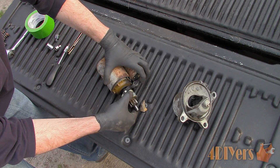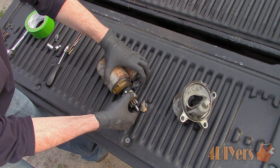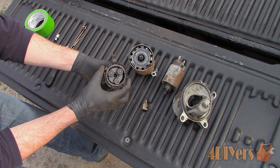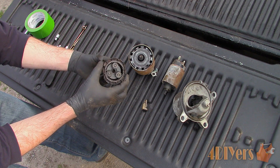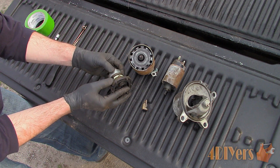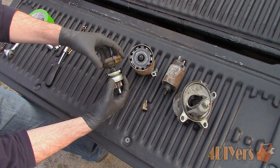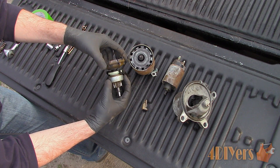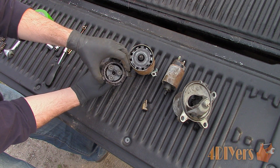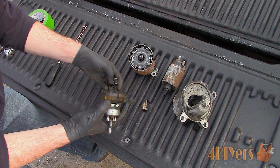The movement of the plunger operates a lever that pulls out the pinion gear. Here we have the final drive assembly. This unit is what gives the starter motor its torque so it's able to have enough power output to turn over the engine. Designs will vary between starters so not all look the same, but will have some similarities. There is a gear on the armature shaft and a planetary gear set in the final drive assembly — roughly a 5 to 1 gear reduction. Therefore the motor will need to turn 5 times, which is equal to 1 revolution of the pinion gear.